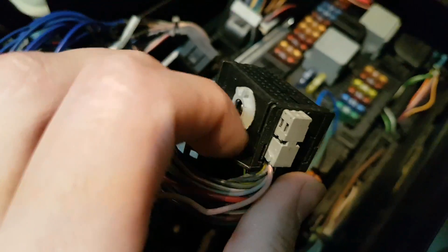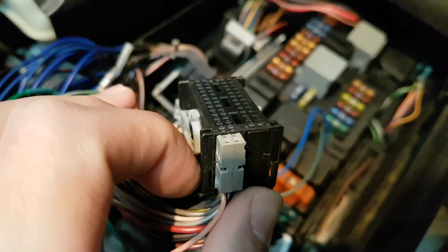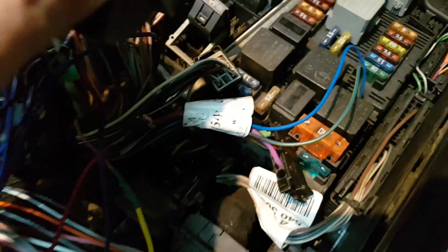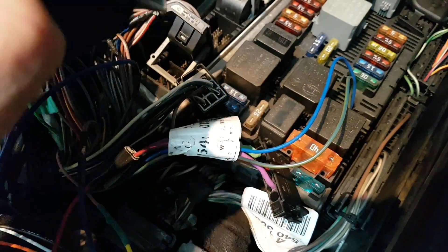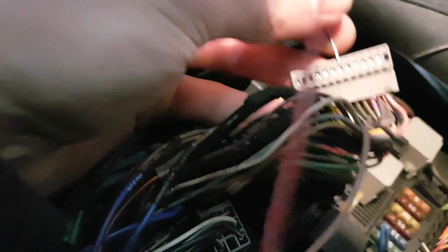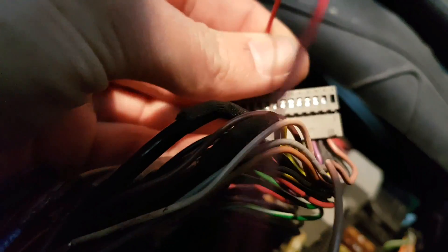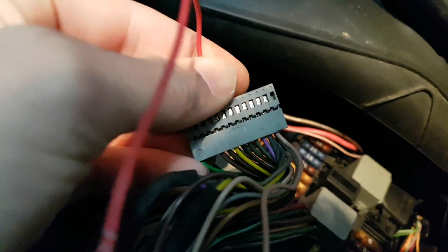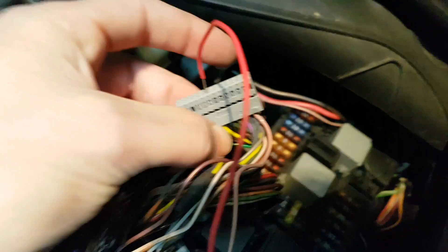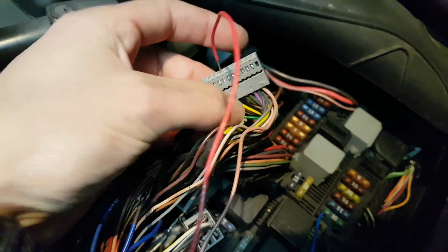For the wires that are harder to get to, you can disassemble the connector to locate the wire. There's just a little tab that you pull back with a small screwdriver, and then you can pull the connector out. Once you have it out, you go to the same pin you identified — for me it was this pin here — and you can see which wire that's going to. So that's obviously going to the yellow wire, meaning my intake air temperature sensor is connected to the yellow wire. I'll label this one and connect it to the FIC. That's how I'm tracing all my wires.